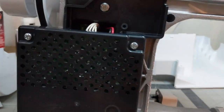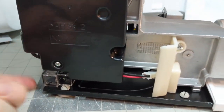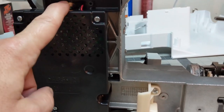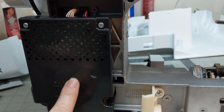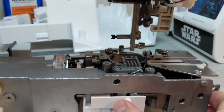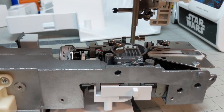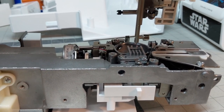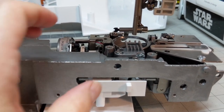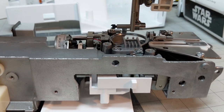Let's look on the back and see if there's anything back here worthy to talk about. This is going to be your high voltage section — your 120 volts comes in from your power on the side here, comes through here, and this is where it turns into power that the computer can use. It turns into a lower voltage up here for your computer, and in DC that's going to be used for the motor. This switch — if you can see the feed dogs, they went down when I switched that. See how they're raising up and down; if you turn them off, it just disengages the feed dogs so they're going to stay down. That's all that switch does — a lot of machines have that switch, and if you accidentally switch it and don't realize what you did, you're going to stop feeding material and wonder why.